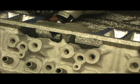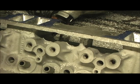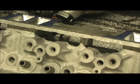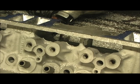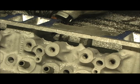There's something else this is about. When a customer gets a head from you, no matter how good of a port job you do, they look at that but they also look at other things — like what I'm doing here, the oil returns cleaned up. I tap and chase all the threads on the head. No head leaves my shop where all the bolt holes all the way around aren't tapped, even ones they might not be using, because nothing is worse than a customer getting a head and going to bolt it on and finding a bolt hole that's stripped or damaged. Now's the time to find that out. Take a few minutes: clean all the passages, tap all the bolt holes, chase and clean them.